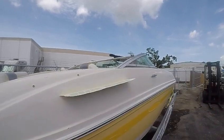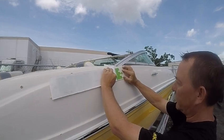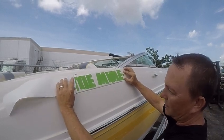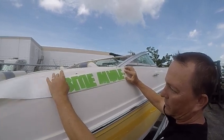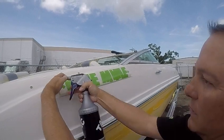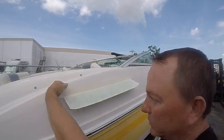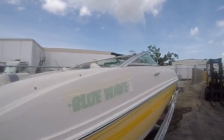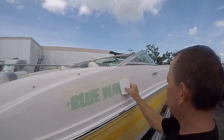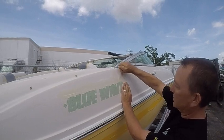From there simply peel it back — you want to leave your diamonds there. Make sure the wind doesn't blow it around. Spray your solution. I'm using a stickier solution so it goes quicker so we don't have a longer video. Squeegee it in place. Now with the soap and water solution you may have to let that set for about 10 minutes before you remove it.